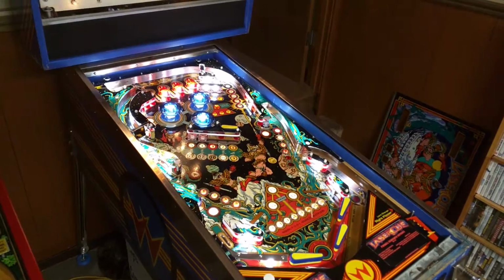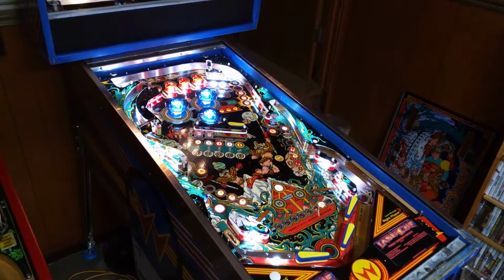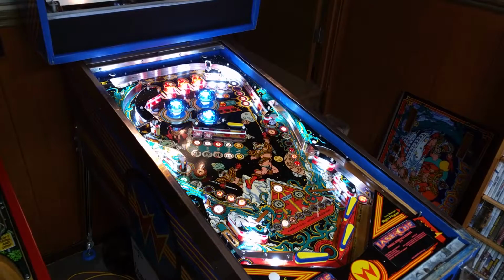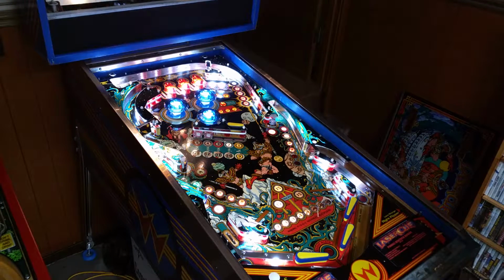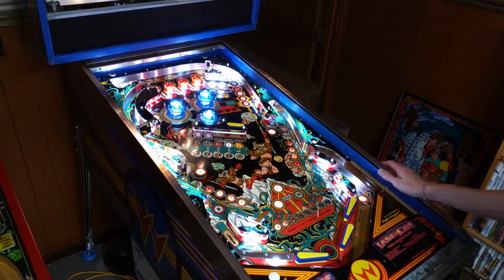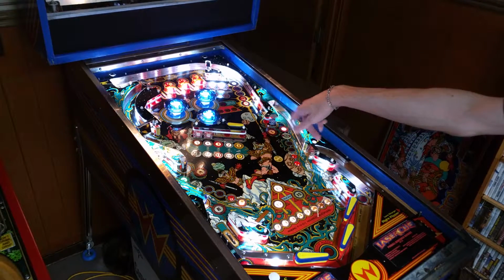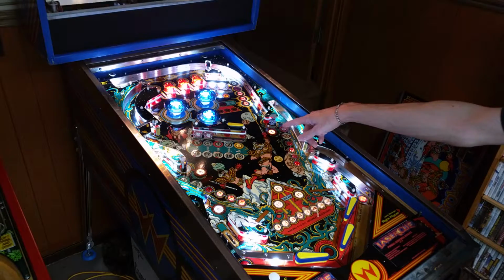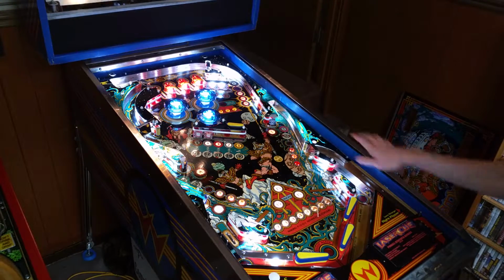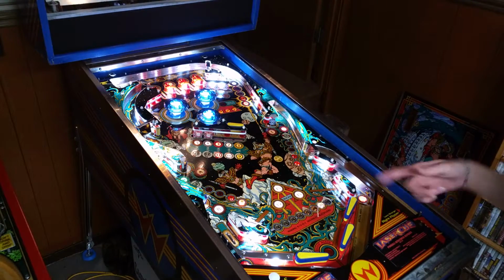So yeah, that's playing real good. Of course, I don't know why it wouldn't play good. Well, I shouldn't say plays good, because the drop downs are wanting to stick. I do have all the coils on. I'm waiting for the coils for this game, because I think the reset coil is the wrong one, and I was going to just redo all the fight bank here with new coils as well, and everything else, which there's not too many coils in this.